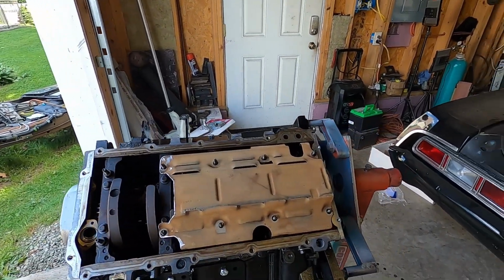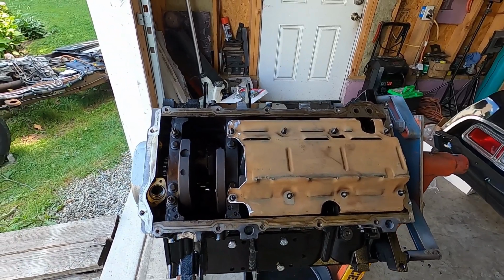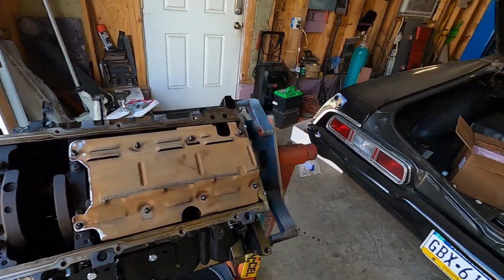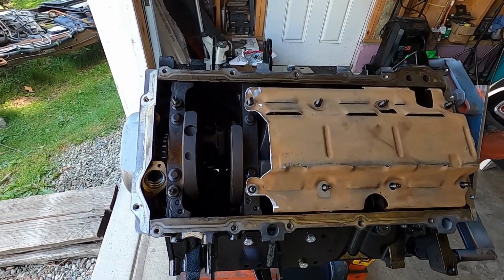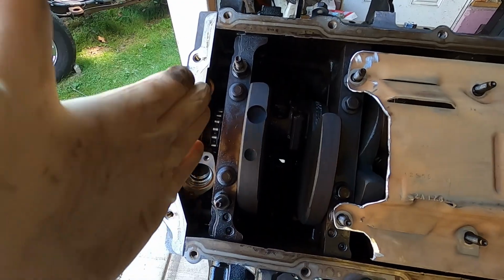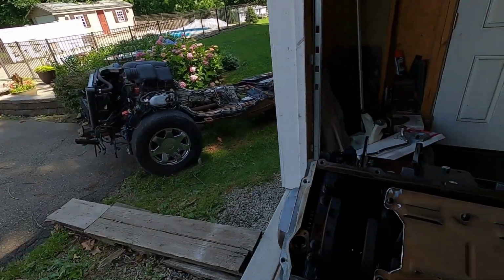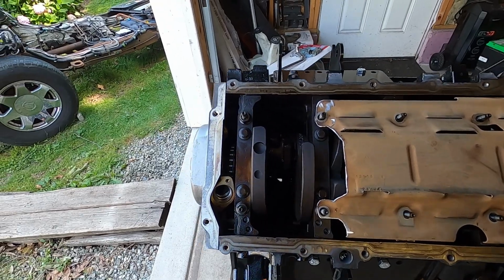It's the engine swap oil pan, and to do that you actually have to remove and modify, as you can see there, your windage tray. So we removed it, marked it out per the Holley instructions, notched a big chunk out. As you can see there, normally this would come all the way up front to here. You remove this section. The Holley pan isn't very deep in that section, and that's so they can get that engine to sit down nice and low in the chassis.